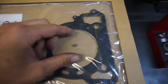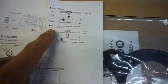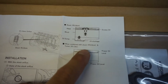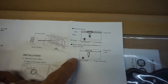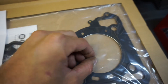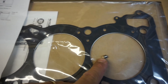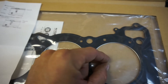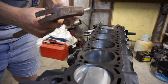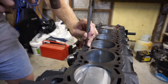It's come with this oil gallery — the smaller one is 1.5mm and the stock one is 2mm, so it just helps restrict oil flow to the head. When you install this, you want to make sure the chamfered edge goes down first. So we'll install that now — take your punch and a hammer and just tap the old one down about 10mm or so.